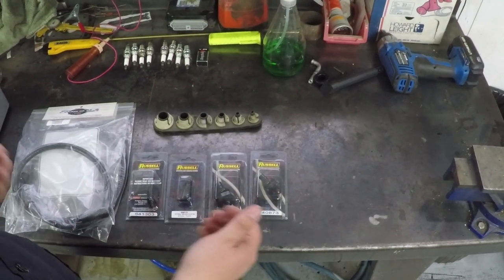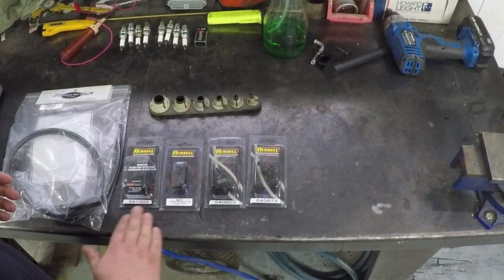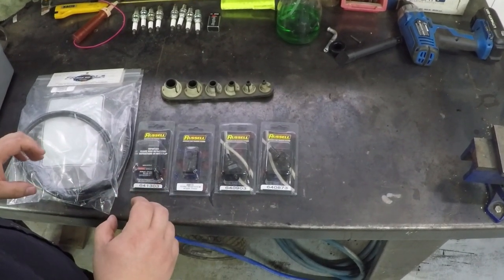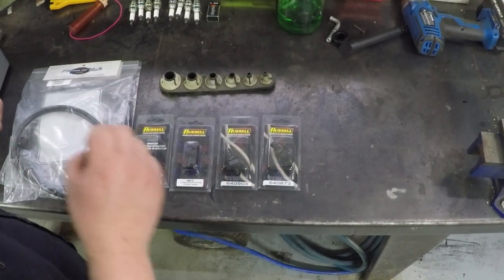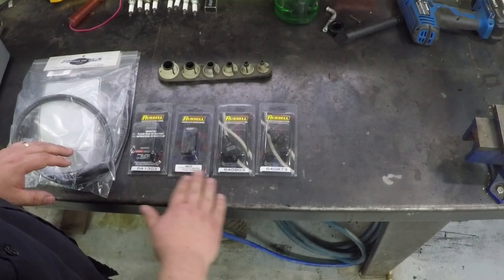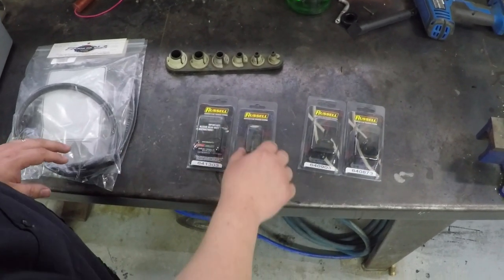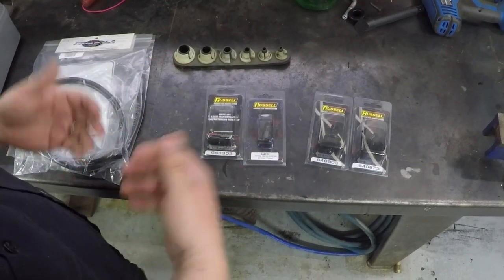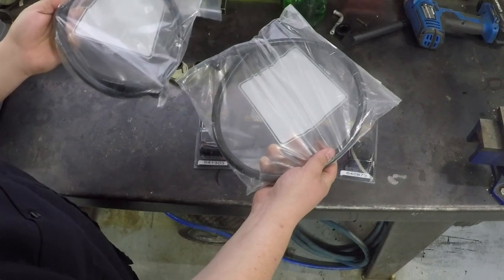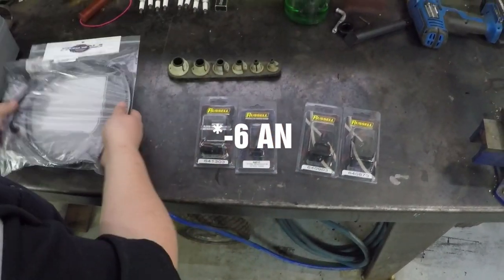Here are the basic parts of the system. You can get these in any number of anodized coatings depending on the manufacturer. You'll see the part numbers here — these are subject to change, as they've evolved since I first researched this about five years ago. In the video description you'll find a list of what these parts are, their numbers, and a description of exactly what you're looking for. For example, this is a dash-six to five-sixteenths SAE quick detach. We have both a supply and return line for the fuel rail side, plus fuel supply and return adapters to the metal hard lines up by the firewall, and two dash-six pre-made nicely coated lines. You can even go up to dash-eight size, appropriate to your horsepower level.